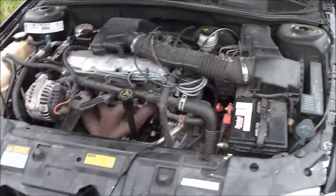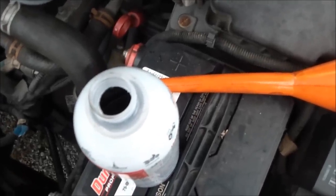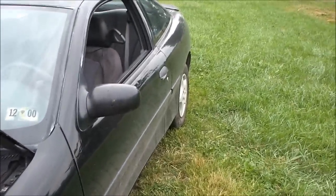What we're going to do is let that sit for a while. Seafoam usually recommends like five to ten minutes. You can kind of see down there — use about a third of the can. We're going to put a third in the engine oil and then take that out when we change it.